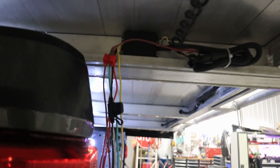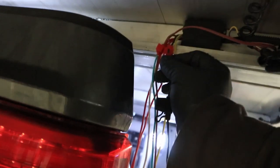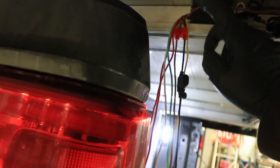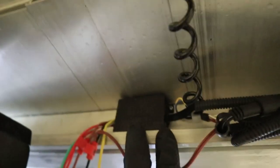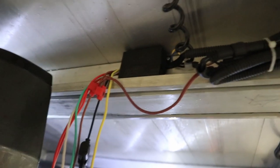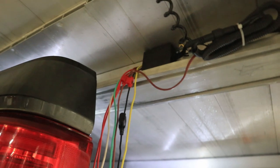Now just one thing I wanted to mention — even when you spend over six grand on this deck, they're just these push-lock wire connectors. I don't like those, so I'm going to be changing those out to crimps with some shrink tube on them. I'm also not very happy with the mounting location of their little electrical box that controls that rear light — it's on the outside, so I want to move it to inside. That'll give it a little more protection.